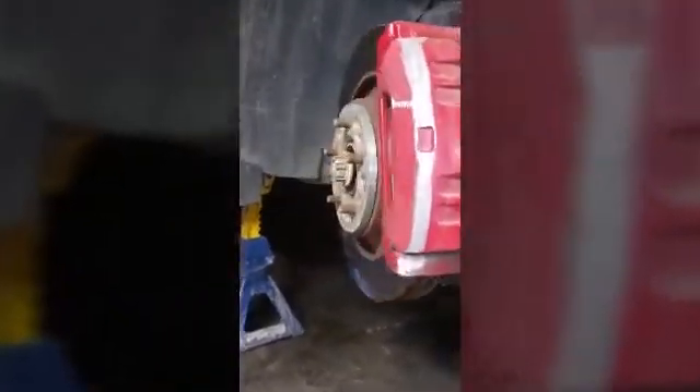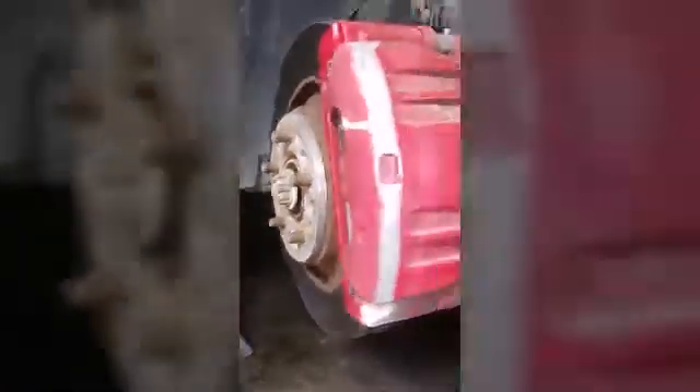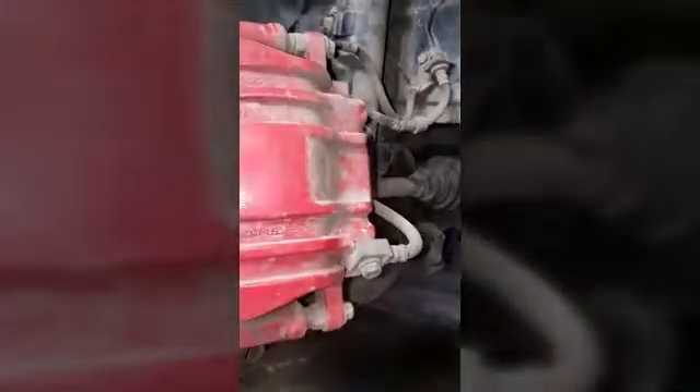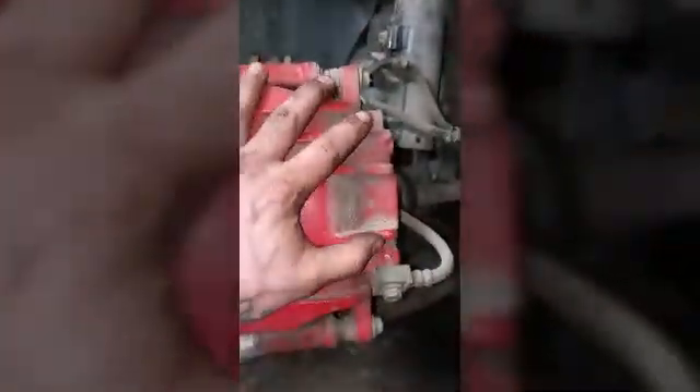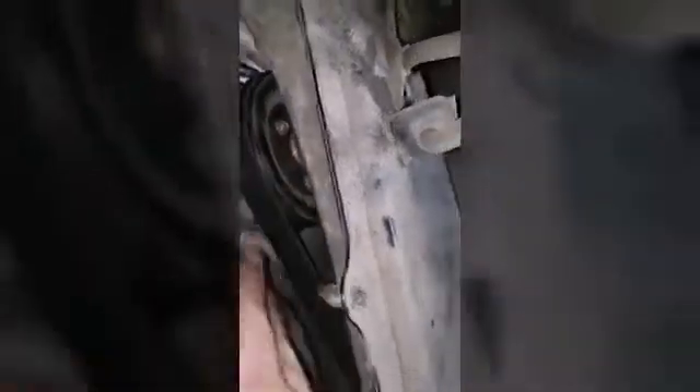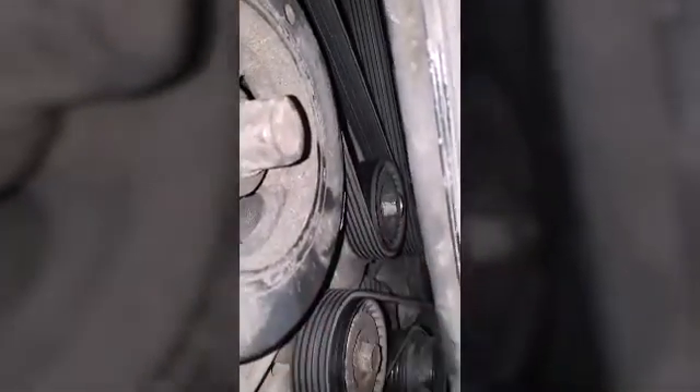Now the tire's off. I forgot that you actually don't have to take the axle bolts off - it's an option if you want to take your rotors and your caliper and everything out of the way, you can drop the axle. It just gives you a little more room. But before you take your serpentine off, your water pump is right there - it's 10 mil, just crack them loose, because it's kind of a pain if you don't. And then you're going to hit the tensioner with a 15 and take the serpentine belt off.